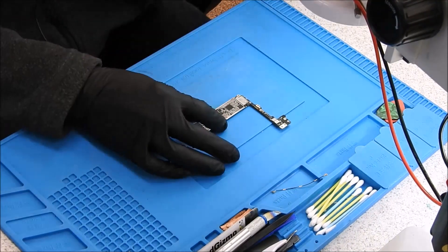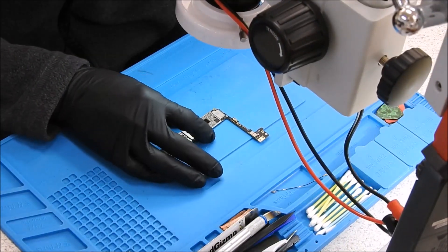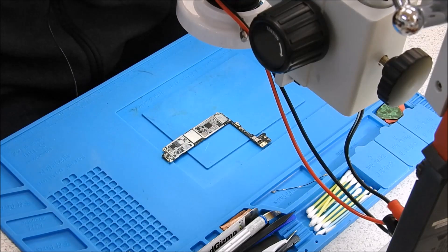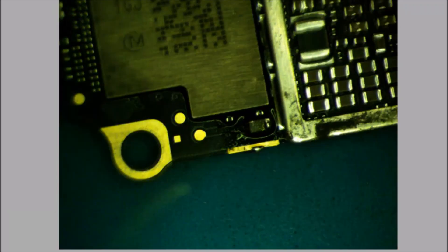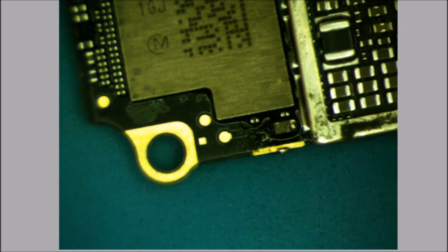Total dead short. So what we are going to do is go under our microscope and double check the VDD main line, make sure that it is actually short. This guy right here is my main — so let's get our multimeter. And we have a dead short. This cap looks a little nasty because I've already been working on this board trying to figure out what's really going on, and I think I have it. So first I removed the MOSFET here and bridged two of those balls together, so I can inject my voltage straight into the battery connector right here — without having that MOSFET get super hot — so we can find the real source of the heat. Let's hook up our power to our DC power supply. And we have an instant 2 amp short to ground.